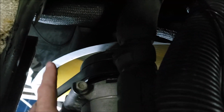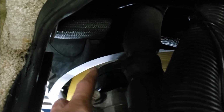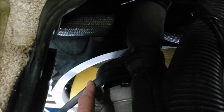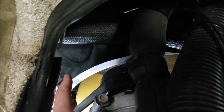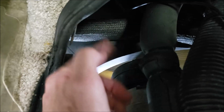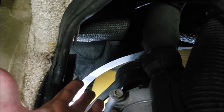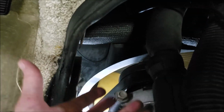On the front pulley, most of the time when the compressor is not on, this acts like a giant idler. The pulley just spins constantly, and it's not rotating the compressor. Only when you flip on the switch to turn on the air conditioning compressor does it lock, and then it's all spinning as one unit. At that time the bearing isn't being spun on its own, it's spinning with the whole compressor.